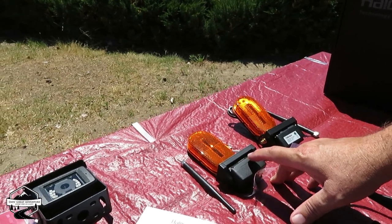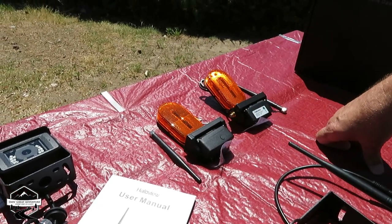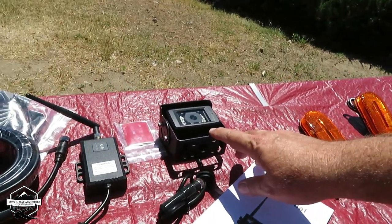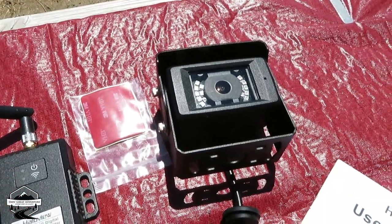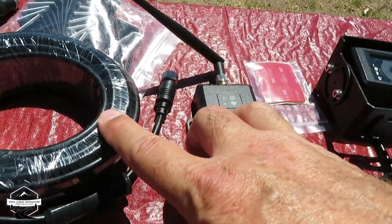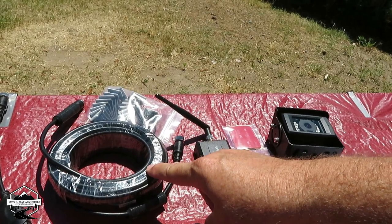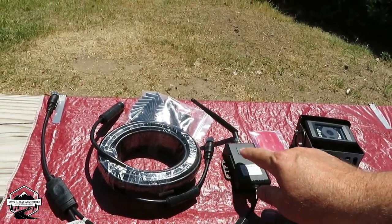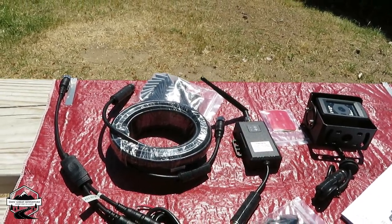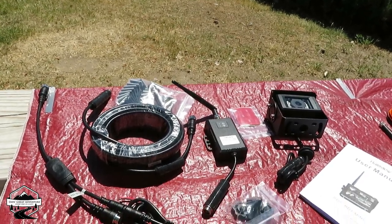It's already one o'clock in the afternoon and it's getting hot. Anyway, these basically replace your side markers but they have a camera so you can actually have a view down the side of the rig as you're traveling. Here's the rear camera, and what's cool with these — they actually have microphones so if you wanted to you can hook up audio. This is the extender for the top and the cable. You put this on the back of the trailer, then run this cable from this into the extender repeater towards the front of the trailer, and that then sends the signal to the monitor so you don't have to worry about it jumping, skipping, and cutting out as you're traveling down the road.